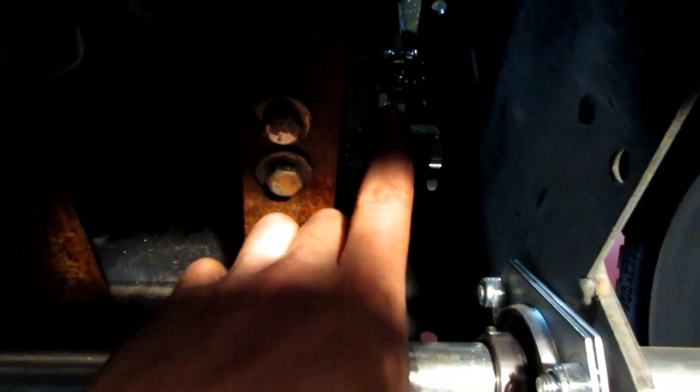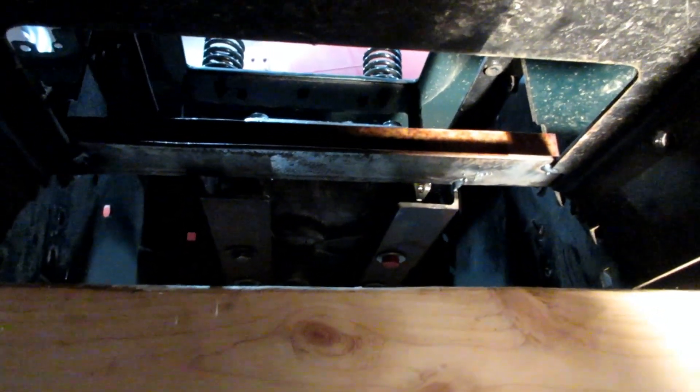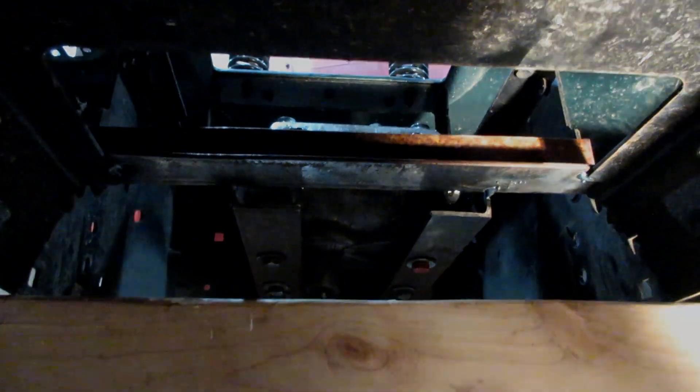Over here, I just have to run a chain from my sprocket here down to some sprocket that'll be right about here somewhere — I'll have just enough room to sneak it over there. I'd rather have it be tight on this side so on the other side I can have plenty of space to get a brake in there. It is still dripping gear oil, so I'll have to get a catch can over here to catch its dribbles — eventually it'll stop once it drips out enough to not be overfilled.